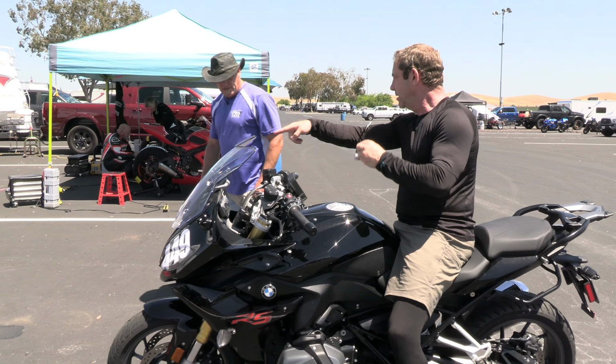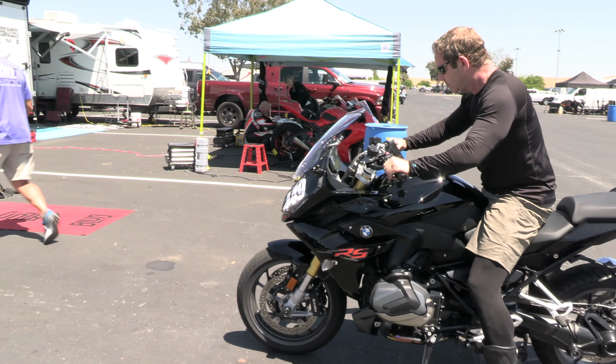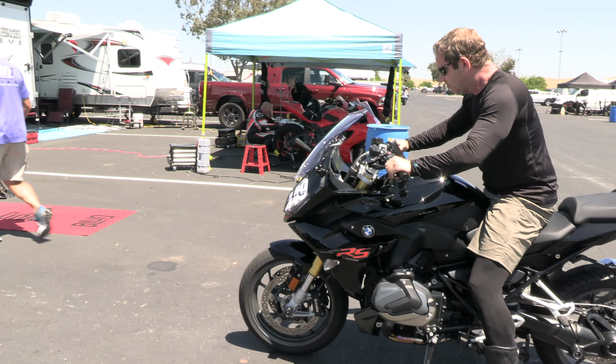Okay. So go ahead, ride it on up. Yes, sir. You need to stay there, relax. First thing we need to do is get into the dash on the settings and see where you are. So there's your suspension icon. All right, so I'm on dynamic and auto. Okay, so let's leave it there so we know where we're at. Now dynamic is the bike feeling the surface of the road, and auto is trying to keep it flat. So at this point, the key is, what does that give us with you sat on it versus off it? And how big or small is what we call sag?